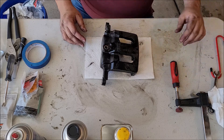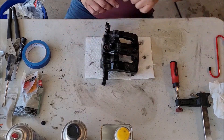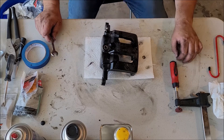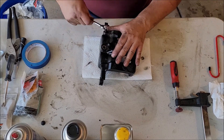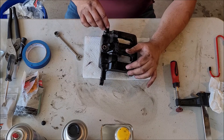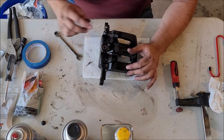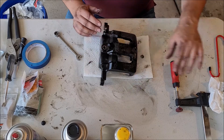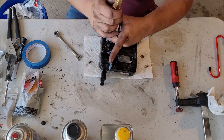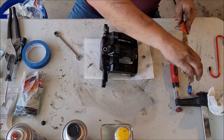To get started, I tried to see if there's any way to get the pistons out without using air — just to see if there's any possible way for somebody to DIY it — but no way that I found works. I've already double-checked that my bleeder screw cracks loose. This side was a lot easier; the other side had a bunch of corrosion in the threads area, so I put a little extra 3-in-1 oil on that. I had to make my own seal out of just some tape, and I just kind of exploded them out of here — that one came out super easy.